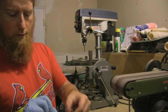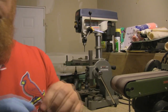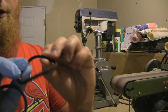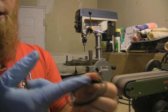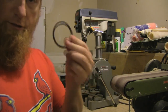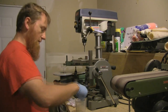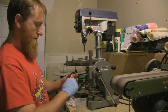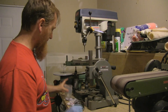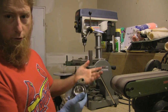Now the slightly thicker seal — this is of note. Both seals have it, but this one's got a little channel in it whereas the thinner one is flat on each side. This is the outer seal. I'm gonna throw a little brake fluid on it to lube it up. This one basically just sets into place no problem.